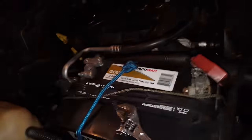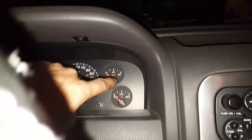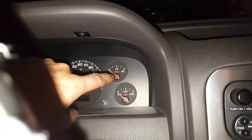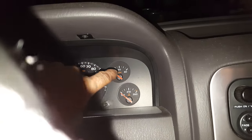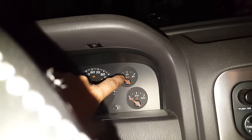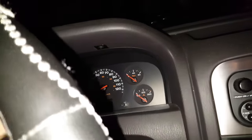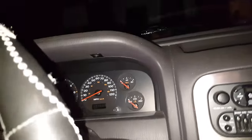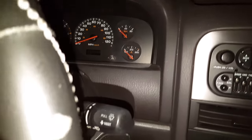A few minutes here — I'll go ahead and start it off for you guys. All right, with all said and done here, let's get inside and start this up. Now before, my pressure indicator would go all the way up to 80 — I should have filmed that but I was in a rush to get this done before the storm. And it would go down to around the 60 area when I get high RPMs going before shifting or whatnot. The lack of power was there obviously too, because either the pressure was really indicating too high or just so far off that God knows what it really was. I didn't use a mechanical pressure gauge to check.